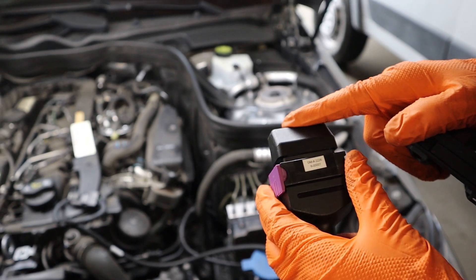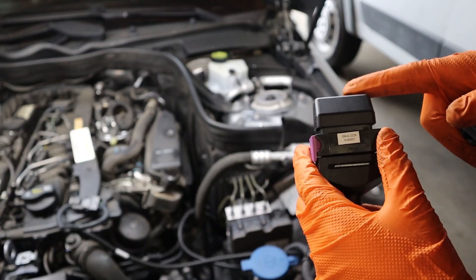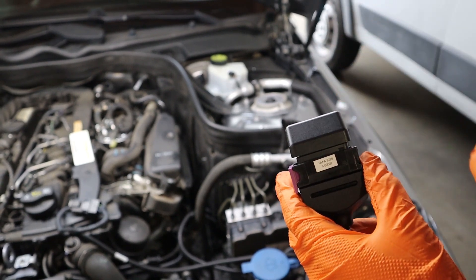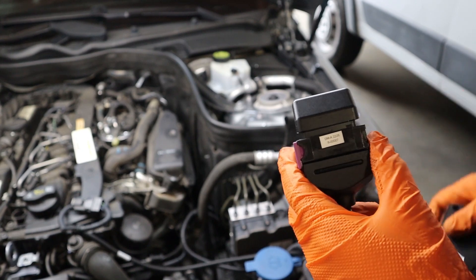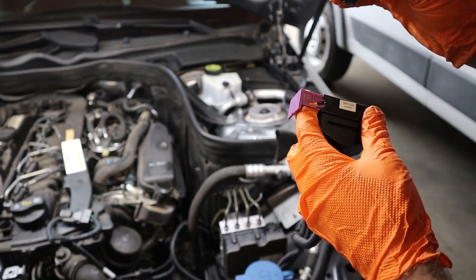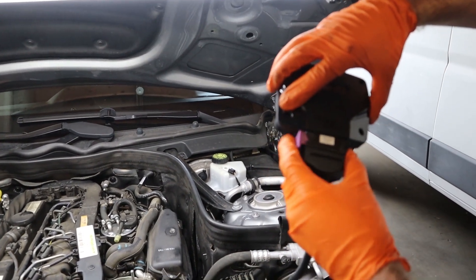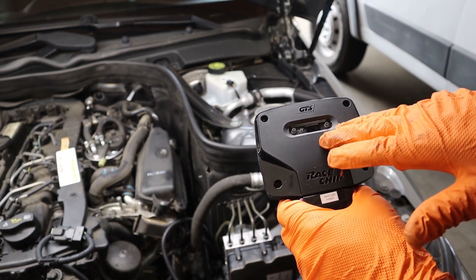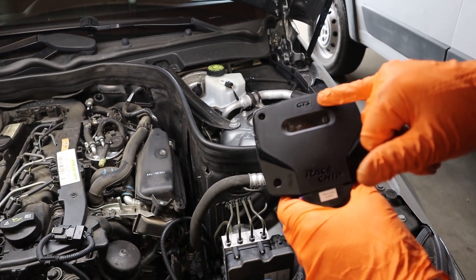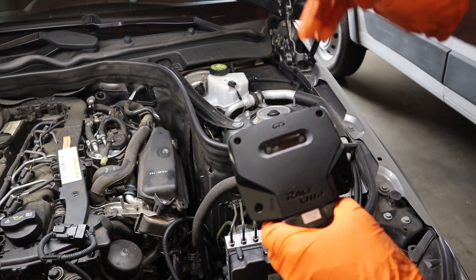The next step is to remove the deactivation plug and replace it with the race chip. Hold on to the deactivation plug — do not throw it away. The deactivation plug is perfect if you ever need to revert the car back to stock without removing the harness; simply remove the race chip and put the deactivation plug in its place. To uninstall the deactivation plug, pull to the side on the purple FCI plug until it unlocks, then pull the deactivation plug out and replace it with the race chip. The first time you install the race chip, if you have the GTS or GTS black, you should get no LEDs on the screen; if you have the S or RS, no green LED should illuminate. It's important that the very first install has absolutely no power going to the engine bay or the harness.